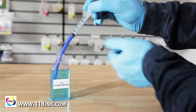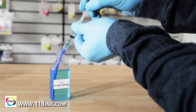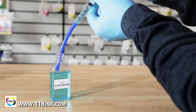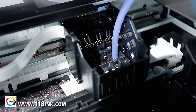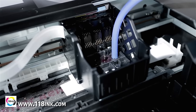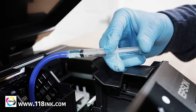With the syringe provided, carefully measure out two to three millilitres of the warmed cleaning solution. Firmly and securely place the hose and syringe onto the printhead, ensuring it is pressed all the way down and is a tight fit. Leave the hose attached like this for about three to five minutes. After a few minutes, slowly and gently use the syringe to flush the printhead with cleaning fluid. Do not force it.